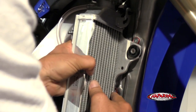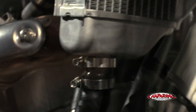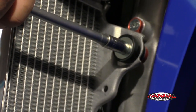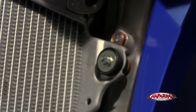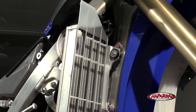Okay, so now we're going to take and reattach the radiator. But first we want to install this hose back in place. With your hose in place, don't tighten this yet because you're going to be moving the radiator around to get the bolts to line up. Don't trust my torque — torque it to the proper spec in your owner's manual. So now we're ready to reinstall our guard. Make sure we go back and tighten our hose clamps.